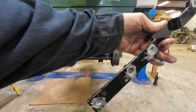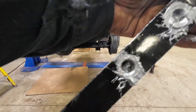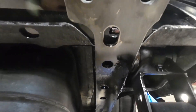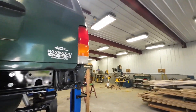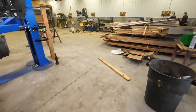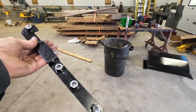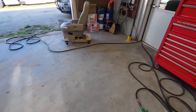The next step is putting this bolt strip in there. As always, goop everything up with that nasty messy anti-seize — the future you or somebody else is going to appreciate that. It's going to go down into the little rat hole here and line up with the bolt holes on the bottom. These bolts — the bumper and the fuel tank are going to share the same holes. I'm going to put stainless steel bolts and stainless steel washers in there. These are steel nuts — not quite as strong, but for what we're doing here they'll be just fine and they'll come out easier.